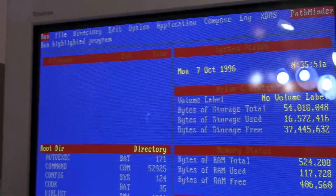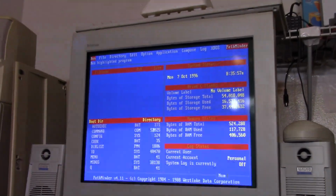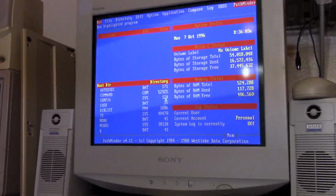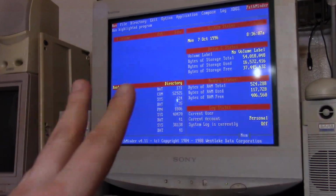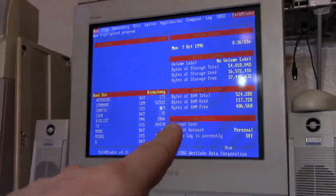I think that's the video card. I think I just threw in like a half-working ISA VGA card, so that's probably the video card, not the machine or the monitor. I'm not sure, but right now it's good enough that it's working. So, cool. It looks like the original hard drive. I had a hard drive controller and an MFM hard drive to throw in here in case the one that's supposed to be in there wasn't working, but it looks like it is.